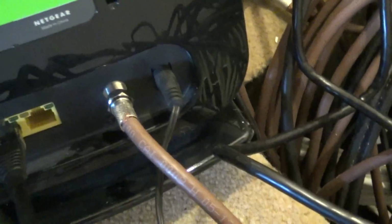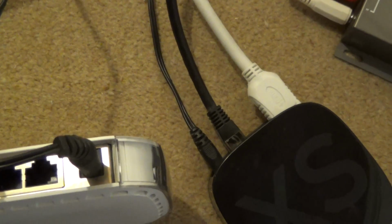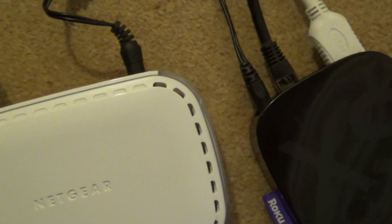So for example, a very quick example now, it's full here and I want to plug in another cable. What you're going to have to do is unplug one of the cables, because you're going to have to put a new cable from the router over to the switch. So get your cable here. In this instance I'm using Cat 6, but Cat 5e is absolutely fine. You plug it into the port that you've unplugged, and then into the back here. Now that's it. My switch is now live from the router, and this frees up 4 more Ethernet ports. The one that you unplugged to allow you to plug into the switch now has to go back into the switch over here. And then you can plug in extra points.